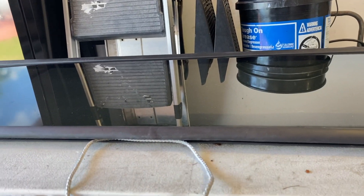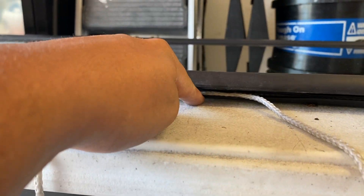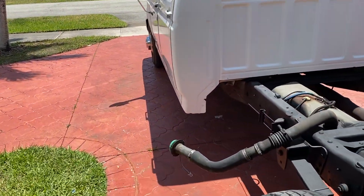All right guys, I'm getting ready to put the back window in. I'm gonna show you how I put it in with a piece of rope — pretty interesting. So I put the rope in through the seal, overlap it on the bottom so it's easier, and then we just pull it once it's on the truck. You get this part of the window and have somebody push it in while you're on the inside pulling the string. When you pull the rope from the inside it'll pull the bottom lip over the metal lip of the window opening and get it over here, hence putting it into place.